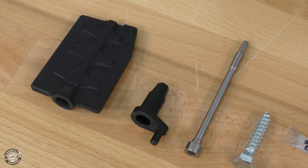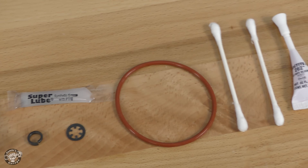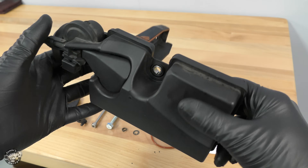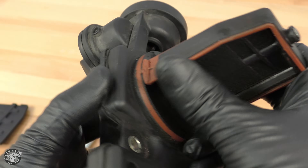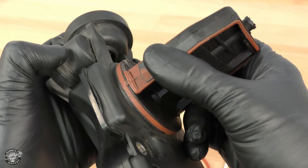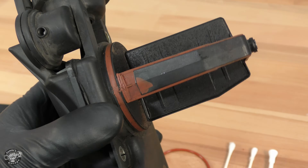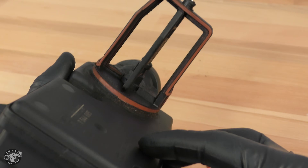We're going to address both of these issues with a rebuild kit not available from BMW, because BMW will only sell you the DISA valve as a complete assembly. Before installing the repair kit, we need to check a few things first. I check to make sure that the housing is in good condition with no cracks or damage. This valve has a diaphragm inside that we need to check. I close the valve, placing my thumb over the vent hole sealing the diaphragm, then let go of the flap. It'll move slightly, but then hold — this indicates that the diaphragm is good. If the diaphragm was leaking, the flap would just open fully while I sealed the vent hole with my thumb, and in that case the entire DISA valve would need to be replaced.